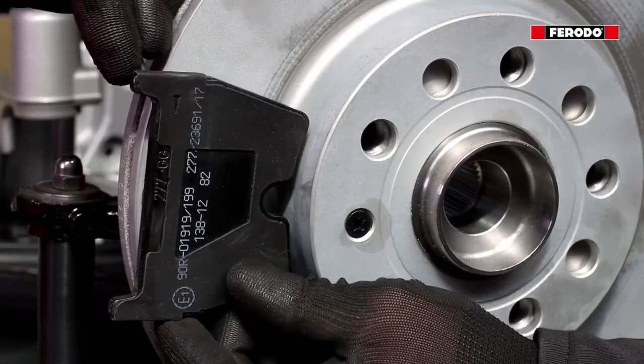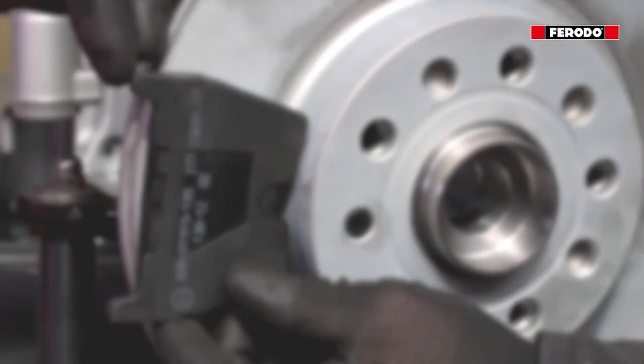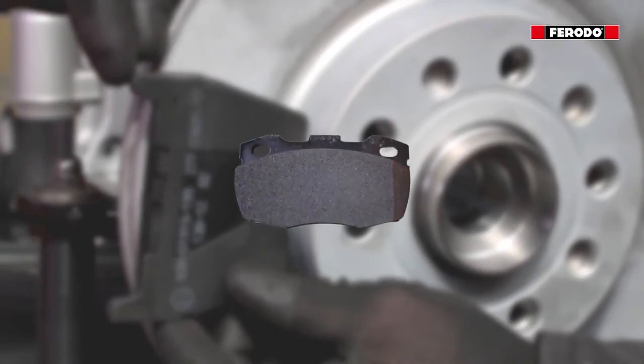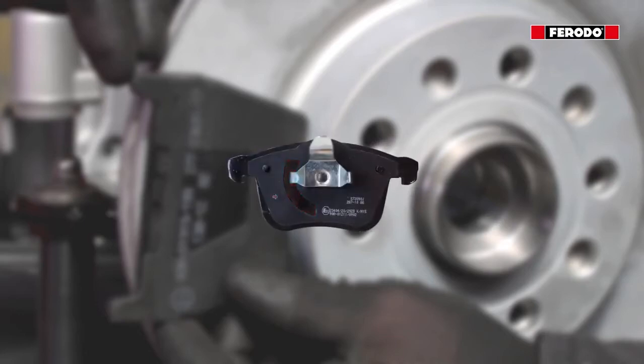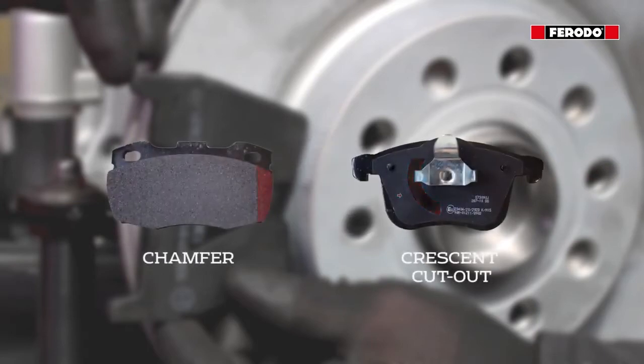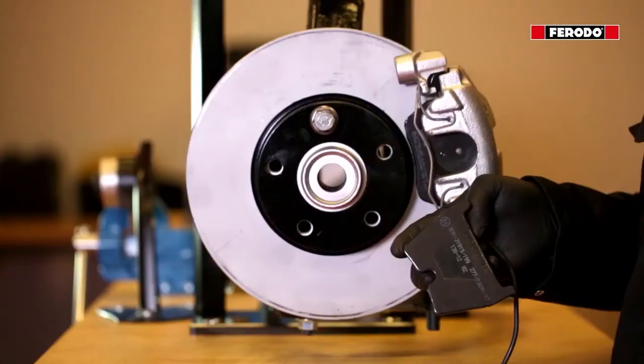In general, there are two directional methods to help reduce brake noise. They are chamfers on the frictional layer of the brake pad, and a cut out from the noise reduction shim on the backing plate of the brake pad. Both of these help to introduce the brake pad to the disc at an angle which will avoid brake noise.